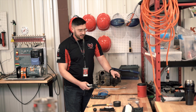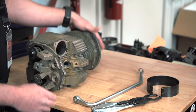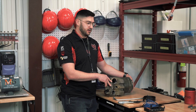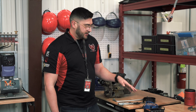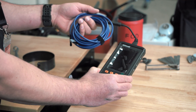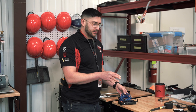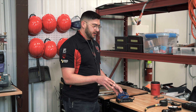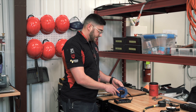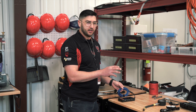Another item is the compression ring wrench, which you're going to use to put onto the pistons and compress those rings to reinsert the piston back into the cylinder when you reinstall. Moving over here, we have an inspection tool which is your borescope. This is very useful when you find damage inside an engine or when inspecting certain components without tearing it apart — you open an inspection port, feed this through, and see what's on the screen in the area you're inspecting.